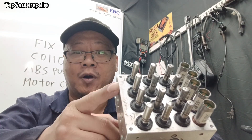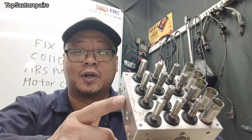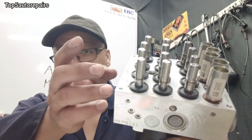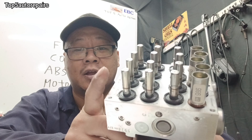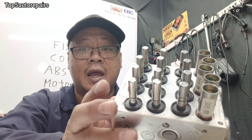Next, you're going to need a wiring diagram and make sure to check for power, and make sure the ground is good and not rusted or corroded. If you can't figure out what the problem is, most likely you're going to have a bad ABS pump and you should replace it. You might also have to reprogram the ABS control module as well.